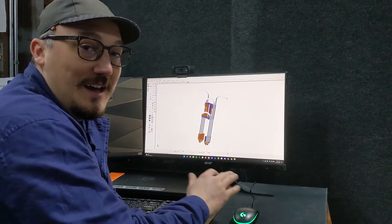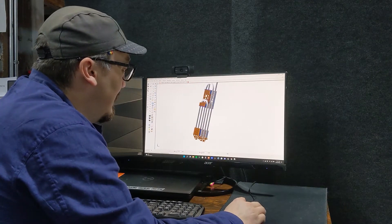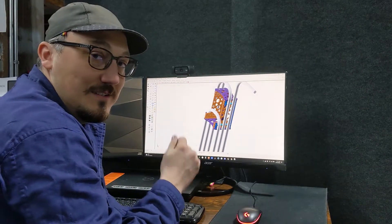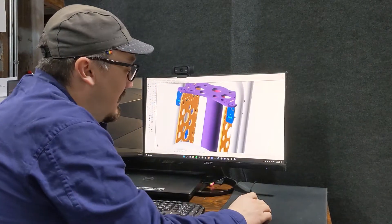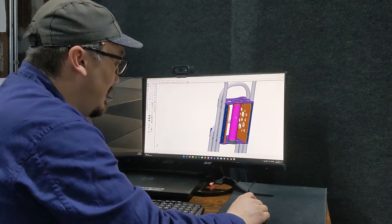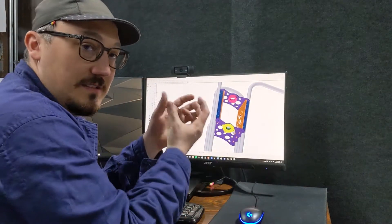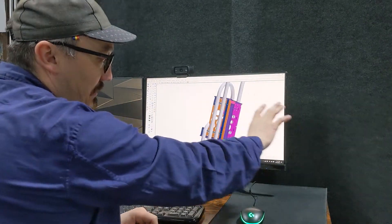So here's the completed CAD of the fork. We have the bottom brackets down here for the front motor wheel, the tube members that are handlebar wire diameter, and then all these brackets with these tiny holes that are going to be lashed together. The way that it interlocks is with these little tabs that will locate everything and hold it in place while it's being lashed. And then the head tube is here, and the steering tube would go up through that and be bolted on from the bottom for this triple tree — that will hold the assembly in place once it's attached to the bike.